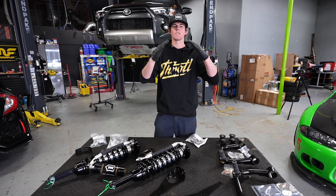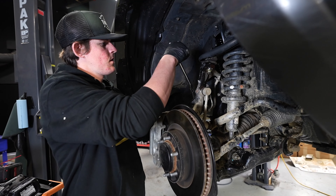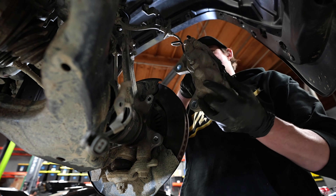We're going to have to do some trimming on the inside of the frame rail and some trimming at the front to clearance the tires. We'll cut the frame out, put these reinforcement pieces back in to add rigidity, and weld it back up. We also have a diff drop kit, which lowers the front differential so it doesn't put as much strain on the CV axles when you lift the truck. A lot of stuff — let's get the old stuff off and start putting the new stuff on.